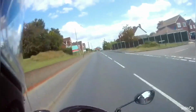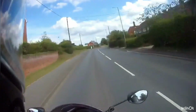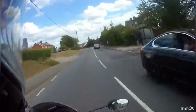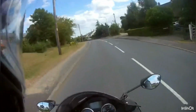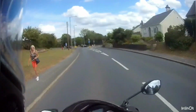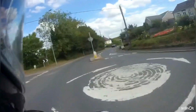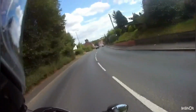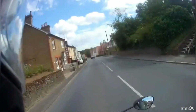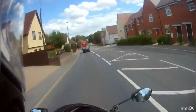Anyway, I thought I'd better mention the traction control on these bikes. It's got the Kawasaki traction control system. You've got 4 stages of traction control: that's off, 1, 2 and 3. I personally tend to ride with it on off or one, depending on road conditions and whatever. If I've got new tyres on, I might stick that up a little bit, but most of the time it'll be off or one.